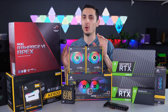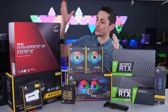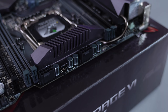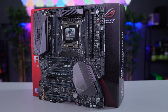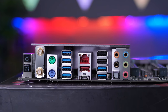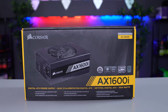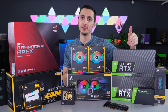Since this is a super high-end water-cooled build with heavy overclocking, there is only one board that can get the job done — the ASUS ROG Rampage 6 Apex. The purpose of the Apex is to break performance records. It has two 8-pin CPU connectors, four separated DIMM slots, four PCIe x16 slots, wireless AC, USB Type-C, and a dual DIMM.2 socket for M.2 SSDs. This is going to be a power-hungry system, so I picked up the Corsair AX1600i PSU. Those are pretty much all the parts, minus the water cooling parts which will arrive before Episode 2.